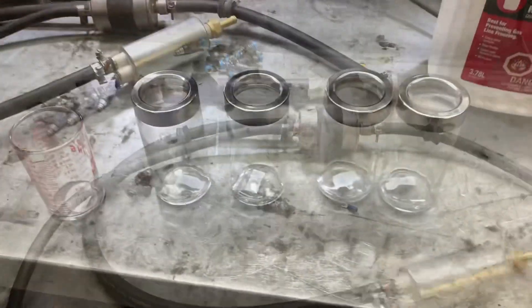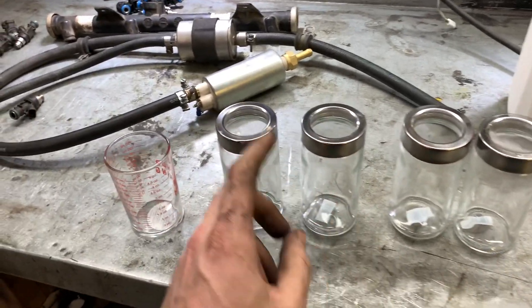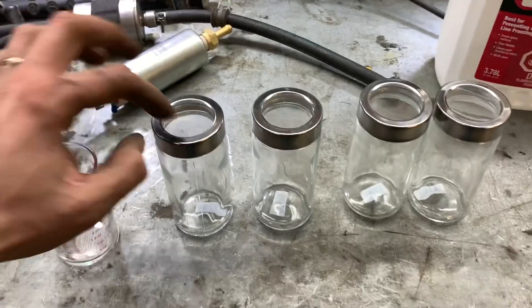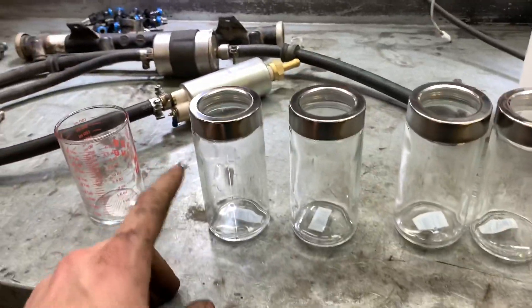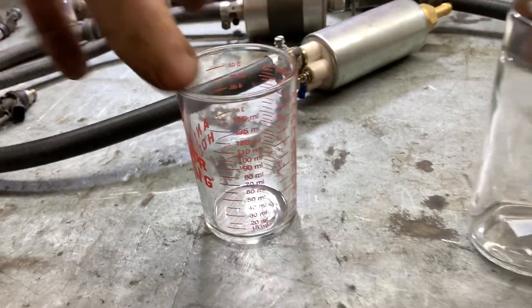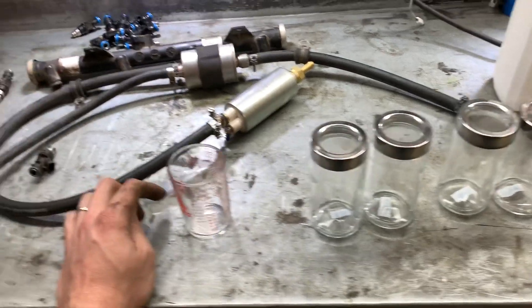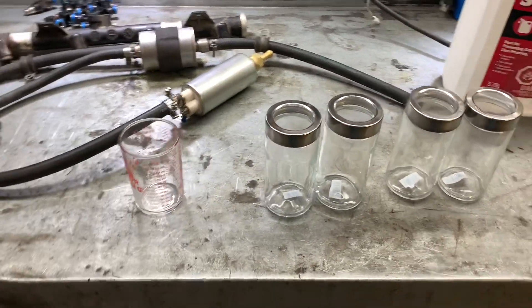So let's get ready and start assembling. One thing I forgot to include is how we're going to be collecting and testing the amount of fluid that the injectors put out. Here's four glass jars I got at the dollar store — they have plastic clear lids. I'll drill a hole a little bit bigger than the injector nose in the plastic cap, just to stop any splash. I'll be using this measuring cup. After each injector is fired — they'll fire all four at the same time — I'll pour it in and measure the ounces or milliliters collected. I'll do it over a certain time, say 10 or 20 seconds, then multiply that out and do some calculations to see how many pounds per hour that would be.